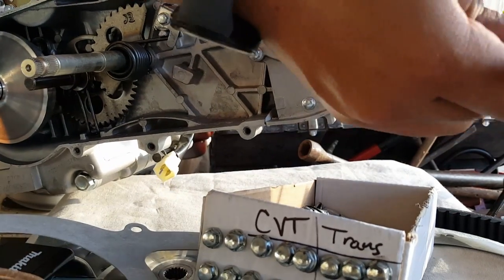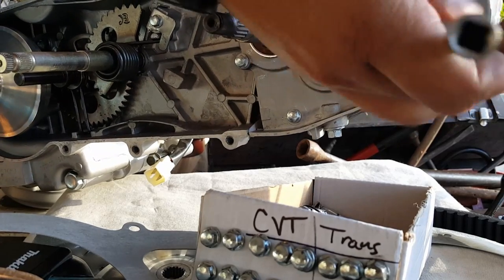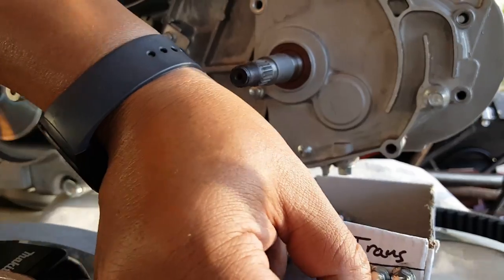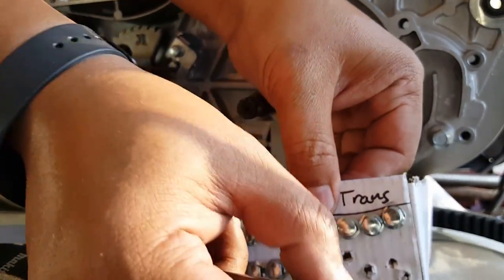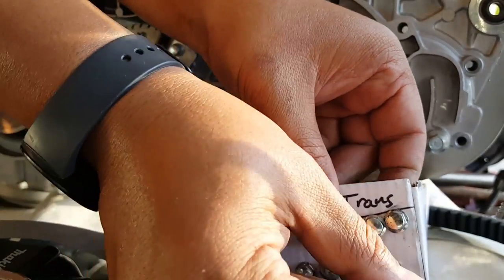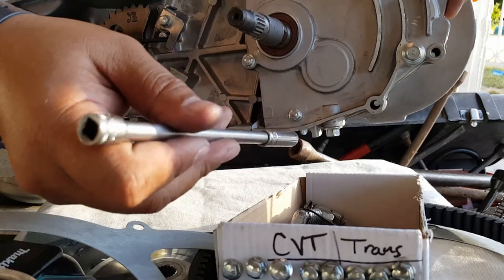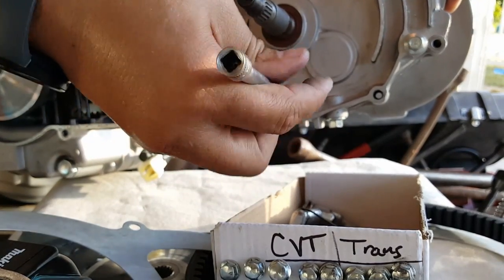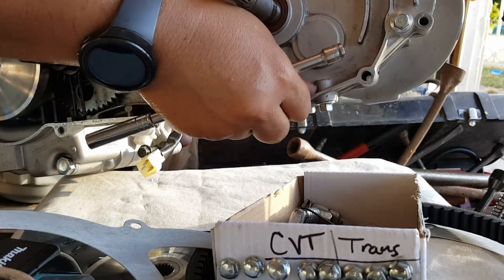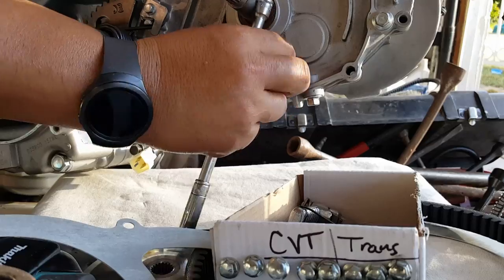These are pre-loosened and the oil has been drained out — the transmission oil. So that's why you won't see much residue because we cleaned it previously. They're also pre-torqued and normally we put some blue Loctite on them. We're going to save the seventh one — the drain bolt — which we don't have to remove for this case. This last one is located on the bottom, and we made a little indent there to help reference it better.